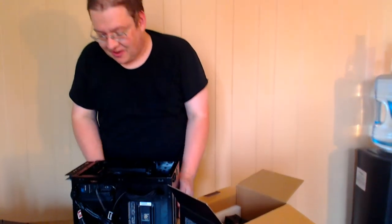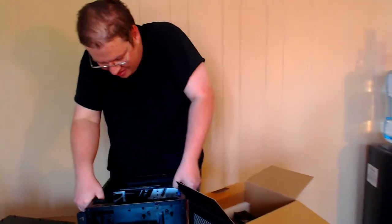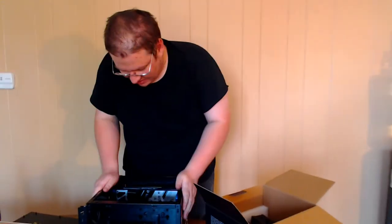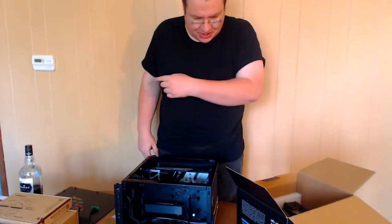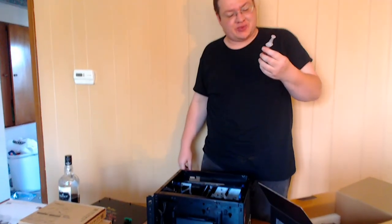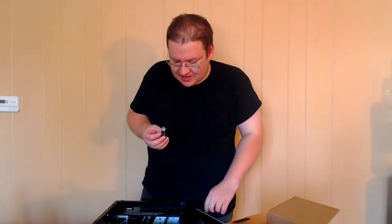Okay. All right. The final touch. The big coup de grace is now up to the humongous chungus. Okay. For this, we will be using Noctua's NT-H1 10-gram thermal paste, which is one of the better ones rated out there that isn't made of conductive metal. And for this, you can unscrew the tip so it keeps it nice and gooey. Gooey. And then you will put a pea-sized blob on the heatsink.